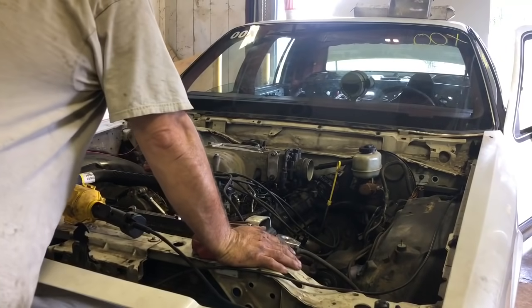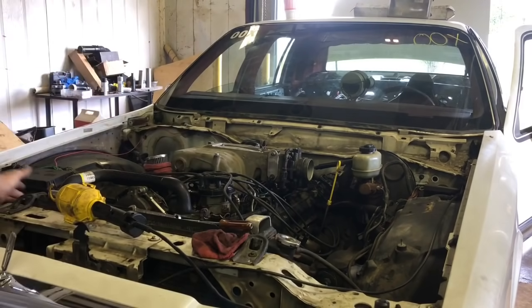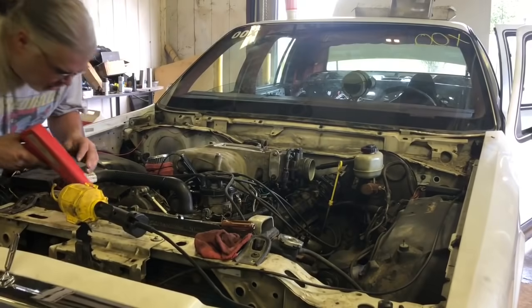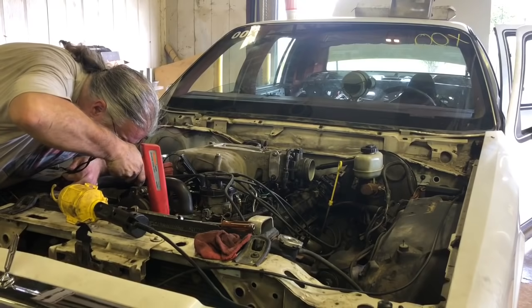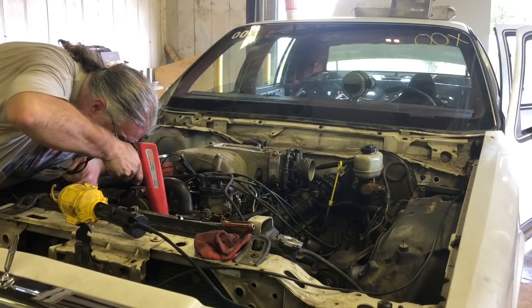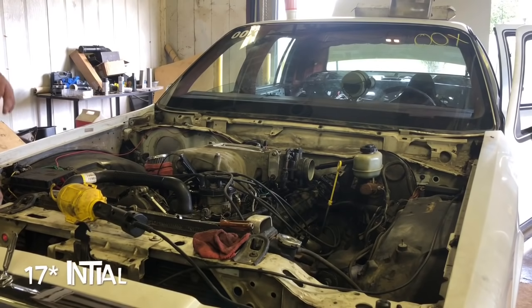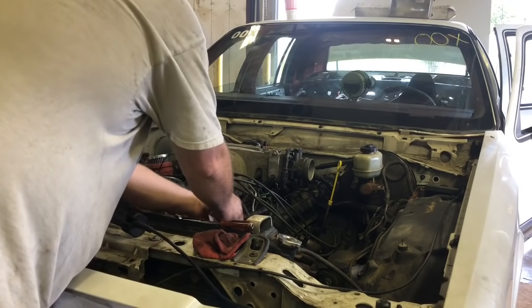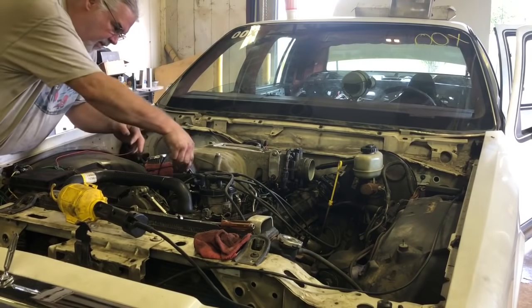All right, well, we need to put some water in it and see what's what. So let me do that real quick. But so far, success. All right, we're gonna check the timing real quick. Ouch, sorry. There we go. Oh wow, we hit. We're on about 17, which is probably a touch high, but we'll see how it works. But we know that we're really in the ballpark.